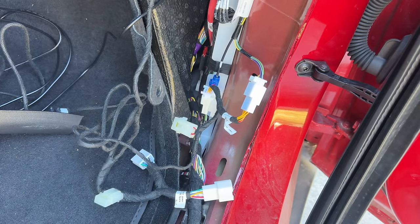We have a fishing wire going from that grommet — sorry the lighting is pretty bad here with direct sunlight. I passed it through on the side and looking inside we found it coming through there. So this is the fishing cable already here. We're going to put some electrical tape on the other side and route it through. We're simply pulling this out so we have that camera cable coming through. Here is the tip of the camera cable and the fishing cable we routed — just use electrical tape to secure it, then pull it from the other side.